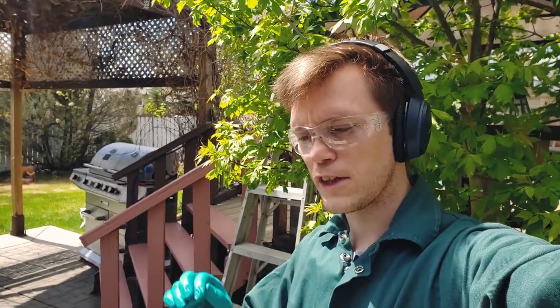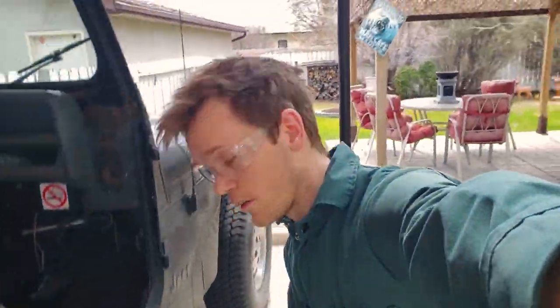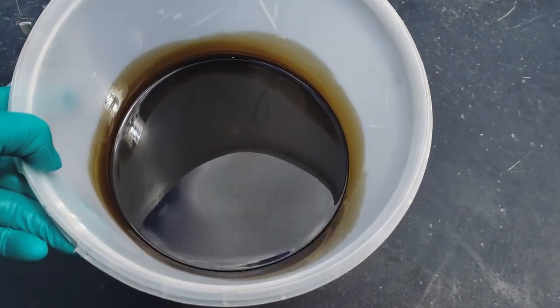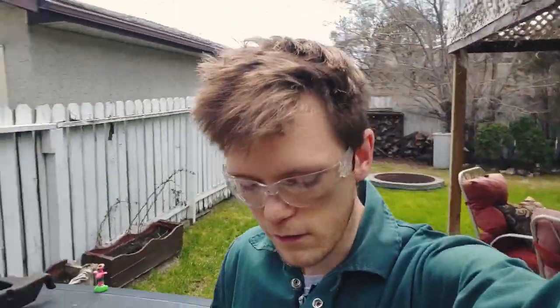First thing on the list: drain a little bit of the oil and see if there's any silver in it. If that checks out, we know it's probably not rod bearings, but I'm going to guess right now that it is rod bearings. Of course, to do that you'll need a 14 or 9/16ths for that oil pan. Now I haven't changed the oil since I got it and I have no idea when the previous owner changed it. I don't see any metal shavings whatsoever. Alright, so that didn't tell me anything.